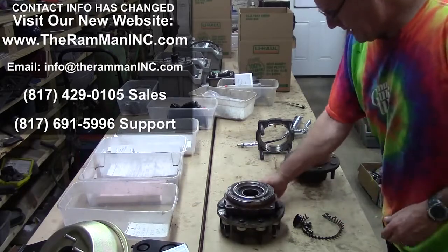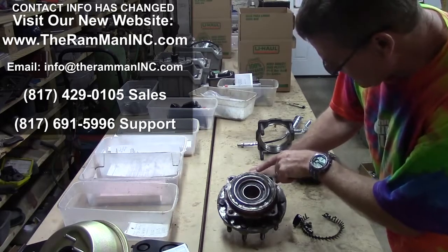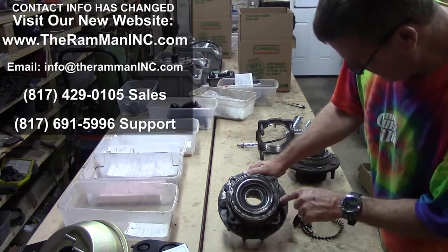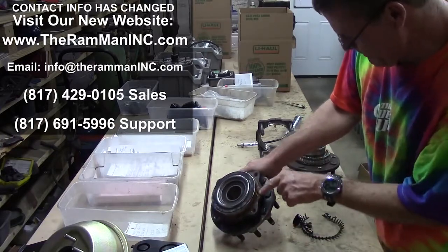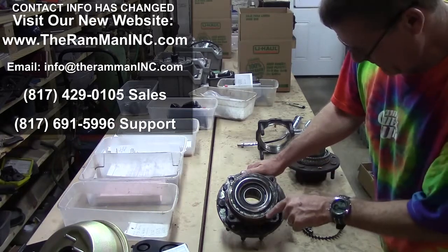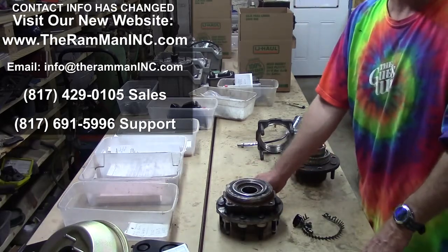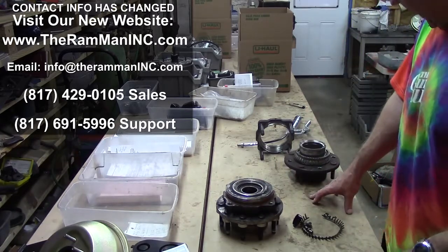Because you do have expansion as things heat up and grease is going to come out. Look at this little bearing right here — this one only got about 20,000 miles on it. If you look right around here, you can see where this grease has been oozing from the seal. That's the only place it is. It is obvious that this unit bearing is leaking grease over time. The evidence is right there. You cannot make something sealed up completely because of expansion, heat expansion, and gases.